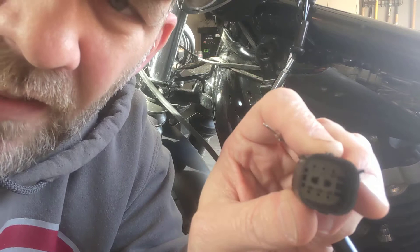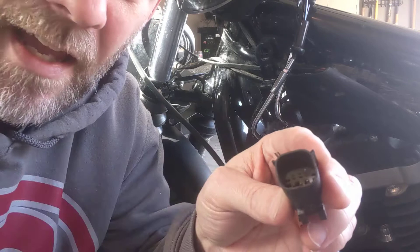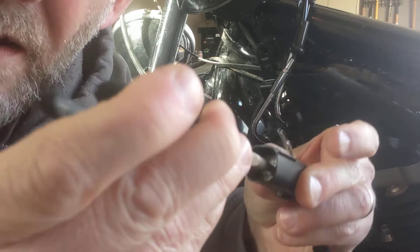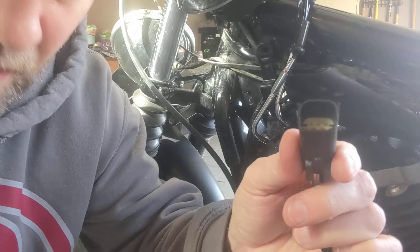Now this is the secret stuff right here. You see in there the pins that you need — with a white plastic piece that's actually a locking piece. It moves forward and back. If you get some small needle nose pliers, you put them right there in those two center holes — just like that — and you can go back, forward, back, forward. You hear that clicking sound? That's it locking these clips in place. So you want to unlock it and bring it towards the opening like that. You hear that click.